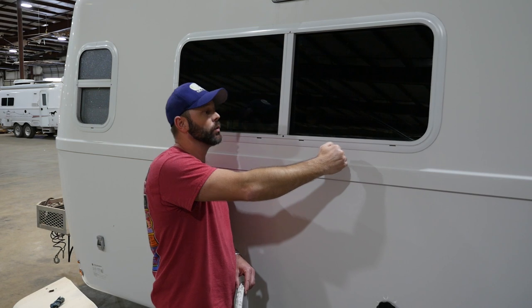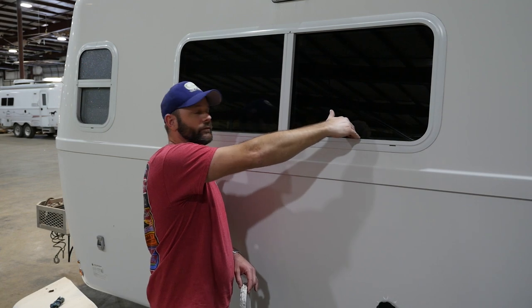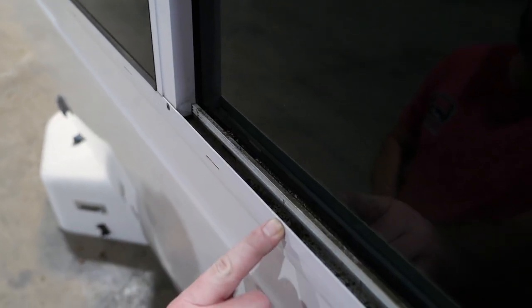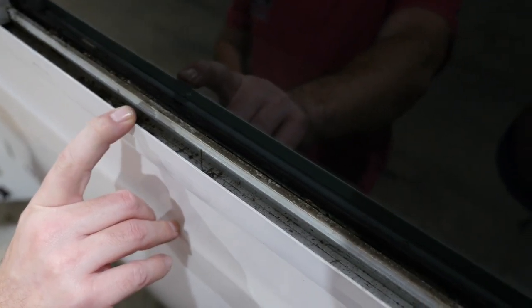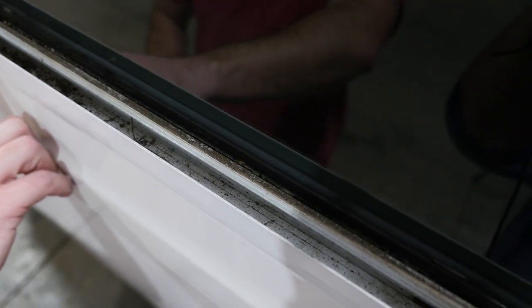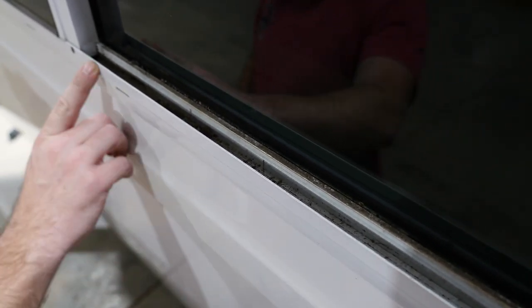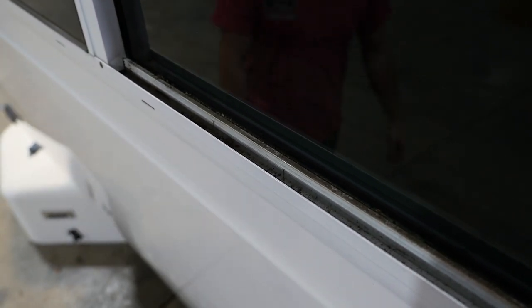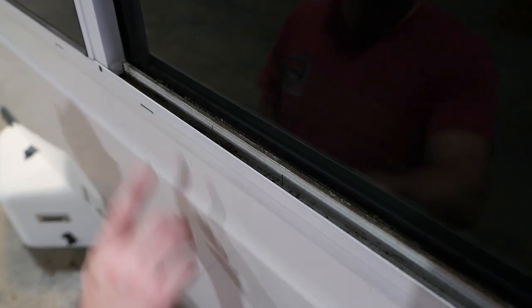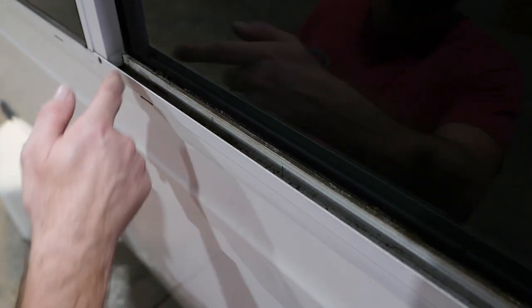You definitely want to make sure it's controlled and coming out of the camper. Looking down inside this window track, you can see a little bit of dirt and debris that has gotten down inside. Once it rains, some water may come out the weep hole, but some of it may actually stop and clog the weep hole up. Every once in a while, you'll want to take this bulb seal out and clean this water track. You may also notice it gets dirty on the other side of the stationary window — you may want to go to the inside and blow it out from the inside so you're blowing it to the outside.